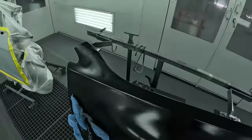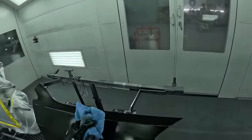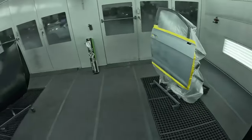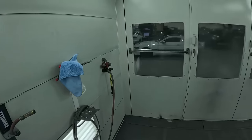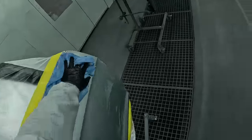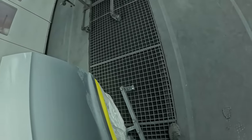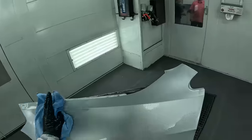All right, we've got our E-coated parts with the solvent, because I did hit these earlier with my normal Prepsol that we were using before. So now we'll go ahead and hit everything with our waterborne cleaner with a different rag, of course. We're gonna go ahead and use our microfiber. You guys know we always start out on the blend panels because it's the cleanest part. And then you'll have to go into your regular sanded parts. That way you have no problems.